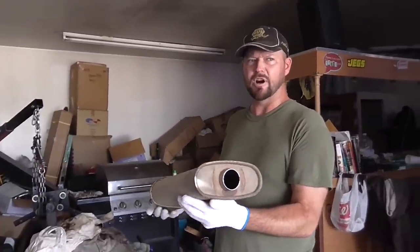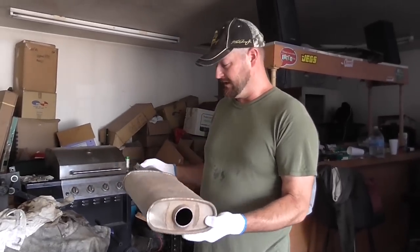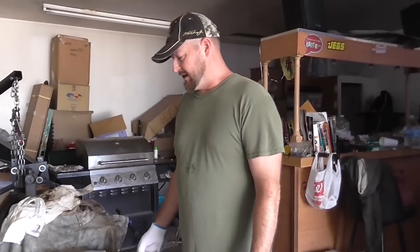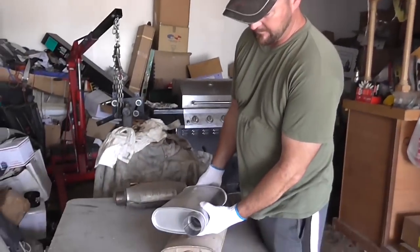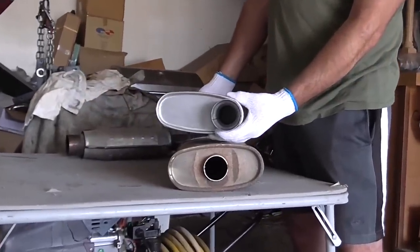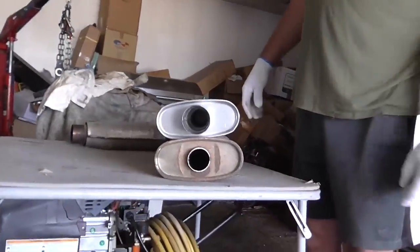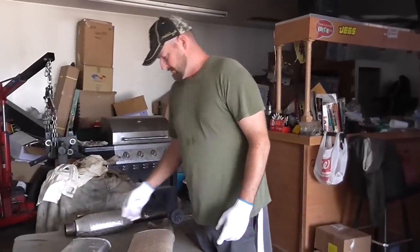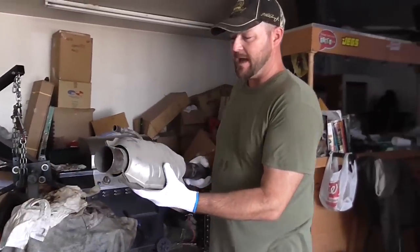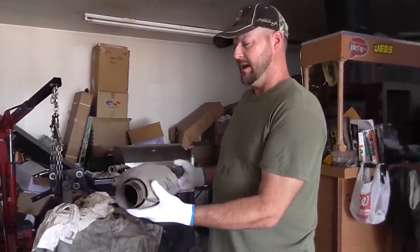Not really heavy on that old of a car — they weren't that heavy. This looks to be an aftermarket replacement, but a stock factory-style replacement, because the stock ones on the Z are kind of bigger and round. And this here is a Cherry Bomb aftermarket turbo muffler. It's a nice muffler, but you can see it has a much bigger inlet and exhaust pipe. This is the outlet; this is the inlet. As you can see, it's much larger than the OEM style muffler. These little differences are quite significant when it comes to expelling exhaust gases — it's so much more smooth. Over here I have what's called a Magnaflow catalytic converter; it's a lot more free-flowing than the stock OEM catalytic converter, and it weighs a lot lighter too.